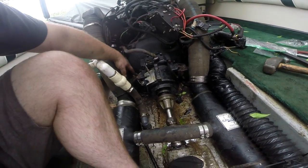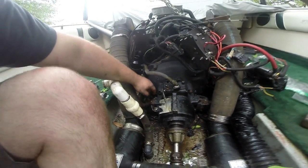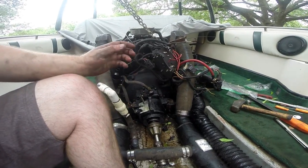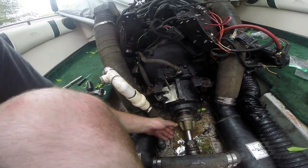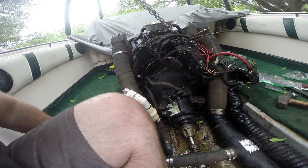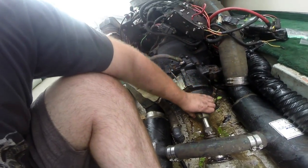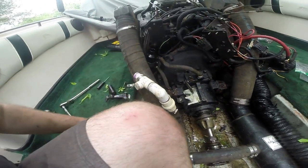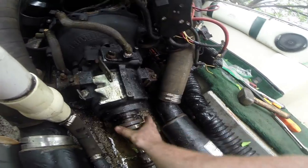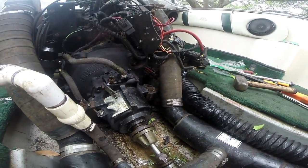Don't worry about it. You will eventually get them to the point where they're showing almost 3/4 of an inch of thread, and then all of a sudden they will pull tight, and it is that pull tight that you're looking for. As you can see, our drive shaft has lined up almost perfectly, and as you remember, on our drive shaft we have this guy and we have this guy. And those two guys that we made are our little alignment marks.